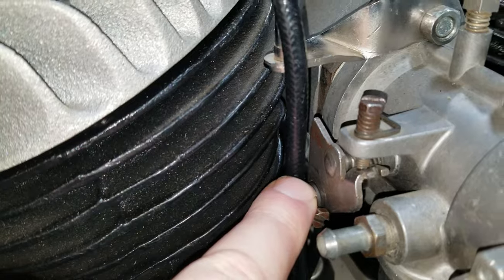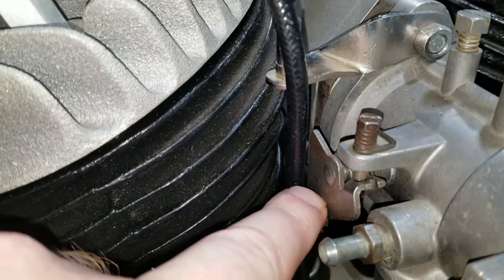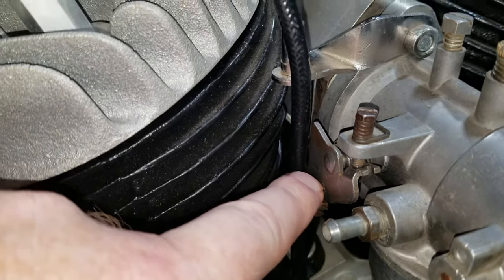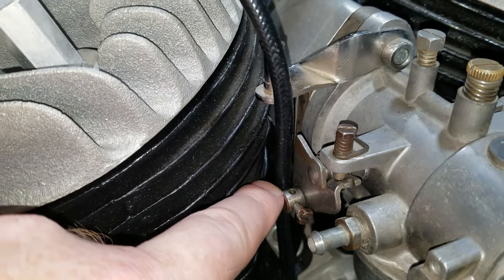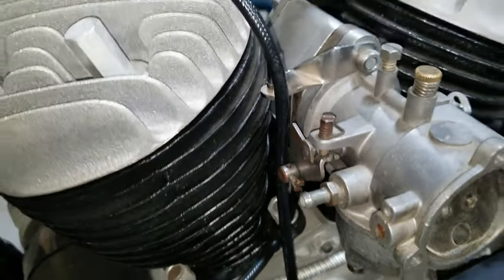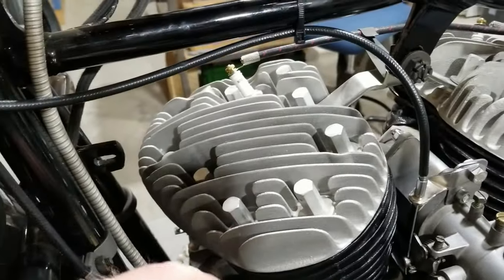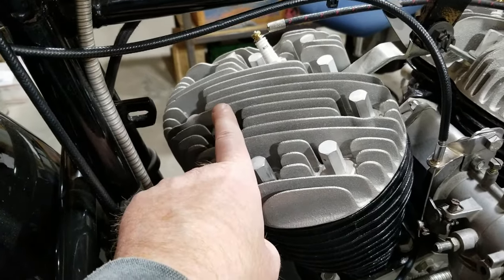The Bendix has a three-quarter inch pull travel and our spiral on our throttle actually moves the cable a whole inch. So we have plenty of movement — no problem hitting the throttle stop, though probably won't ride it like that. We kind of customized the routing of the cable here. We were going to run that taller bracket but it was pulling it down too close to the head.